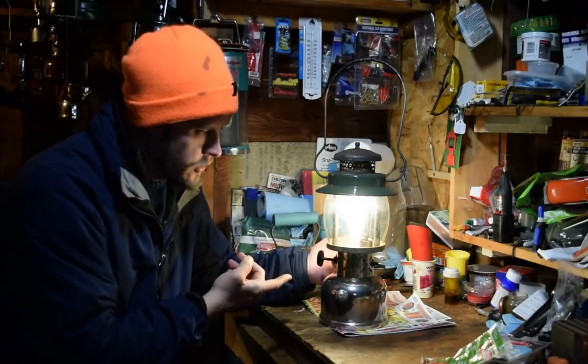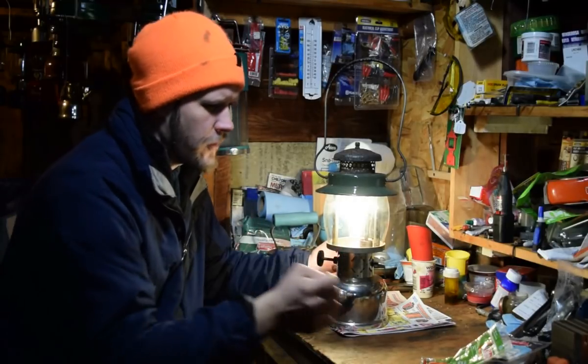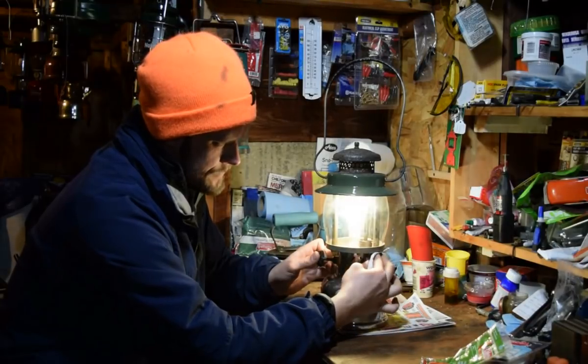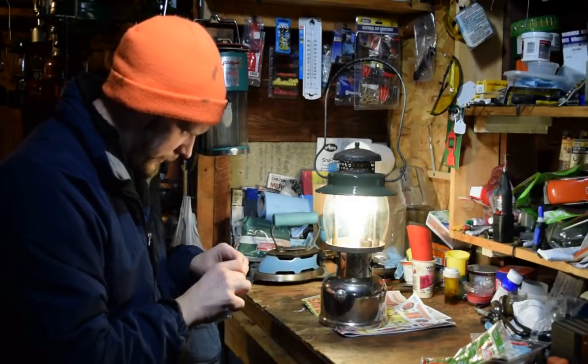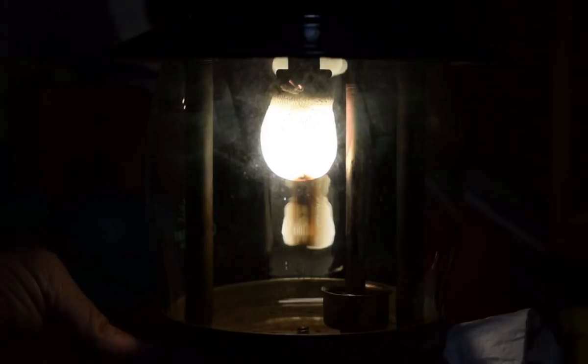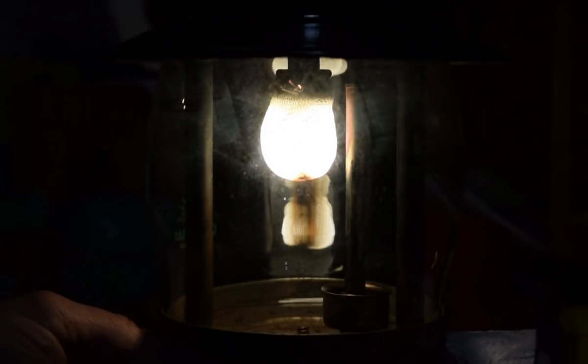237s are really easy to show you not enough air because you can plug the air tubes from the outside. Youch, that is hot. See the significant dimming? We'll cover both air tubes at the same time. I'll get you some overburn. There we go. You see that? See how the flame comes out around the mantle? And I can actually see flames up through the vent.